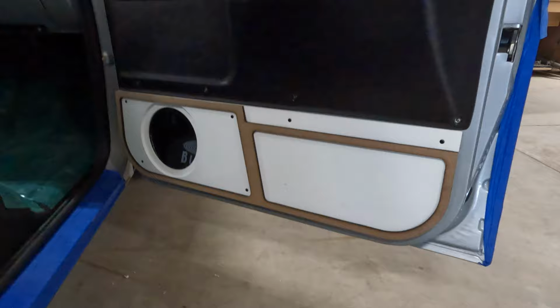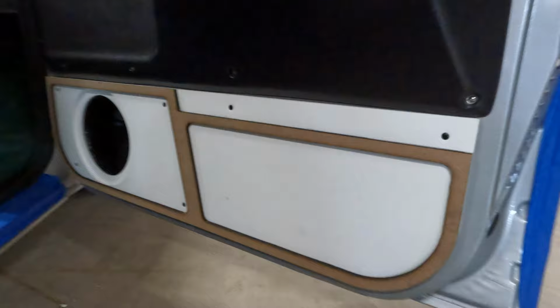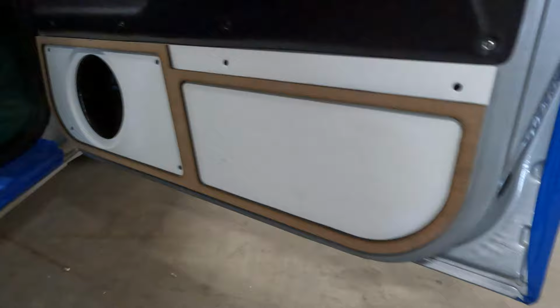We do have them mounted. Again, we just put some screws in there as part of our mounting system. We use that just to line the holes up, make sure everything fits appropriately, and then we'll go back to put the thread certs in it and stuff. That way there's machine hardware in there, and it's a more serviceable panel at that point.